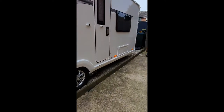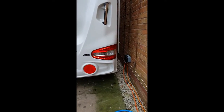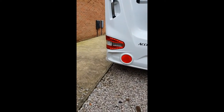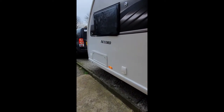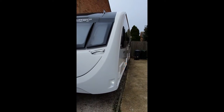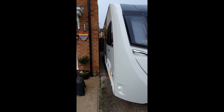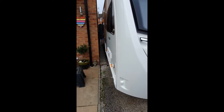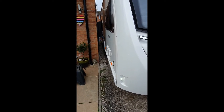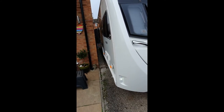So is there a fault with that tester, or is it some sort of incompatibility with a CANBUS system on the Discovery? Both tail lights are on. I'm a bit perplexed because the tester indicated both weren't working, but as you can see the lights are on that side, and lights are on the other side as well. So that is both left and right rear tail lights working — works on both sides of the car and both sides of the caravan. What I think it might be is an incompatibility between the Discovery and the Maypole tester, but I'll do some more research.